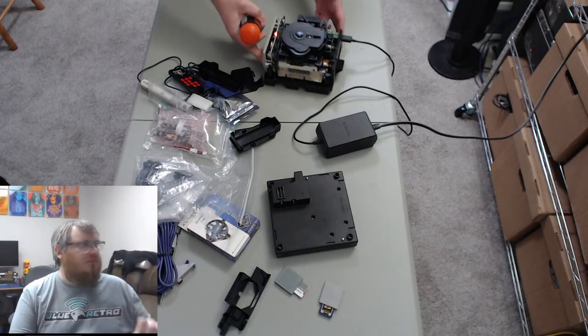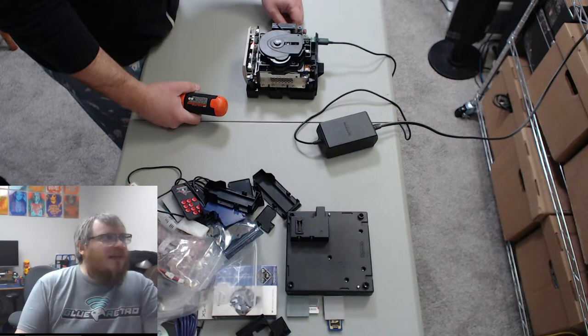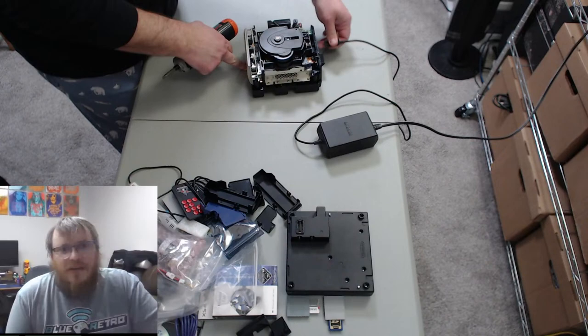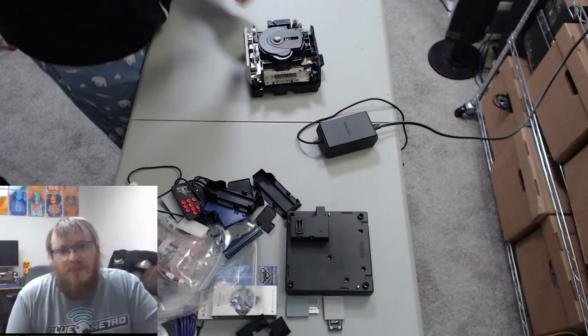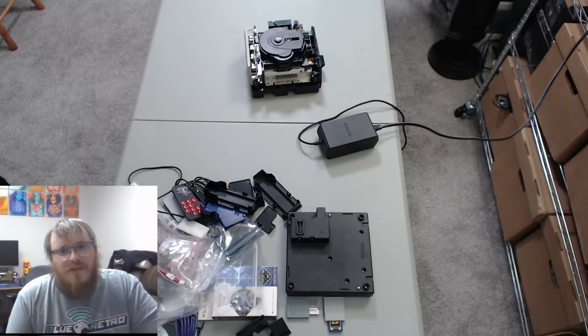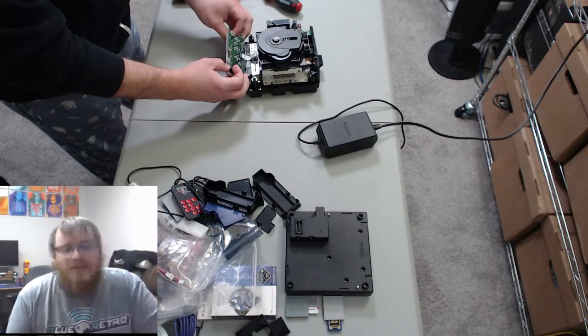So we have this thing heating up, and it's probably it, right? We only need a few minutes to get it warm. Yeah, you just want the thermal pads to kind of be less sticky. So do I unbolt all of these on the sides now? Like, take pretty much every screw out of the console to do the Pico mod, because you have to take it all the way down to the bare circuit board. Yeah, so this is why working on GameCube annoys me sometimes. Oh yeah, there's so many screws. You can pull your front controller board forward. There's two little tab clicks on the sides of it. And then pull the ribbon cable out and set it aside, because you're not going to need that until we put the Blue Retro board back into it.